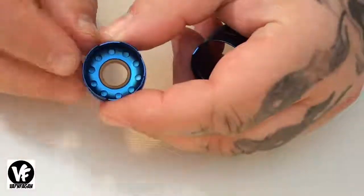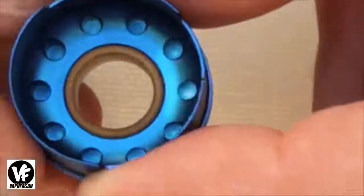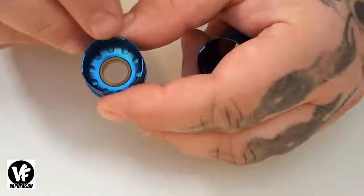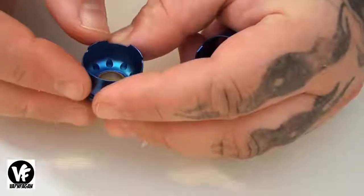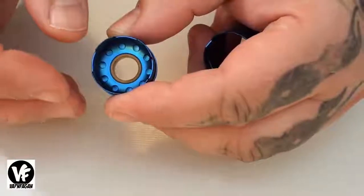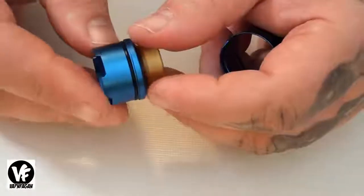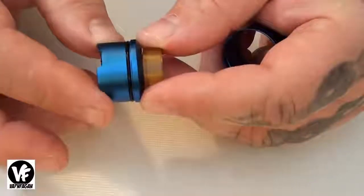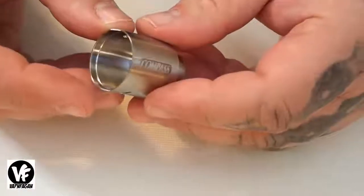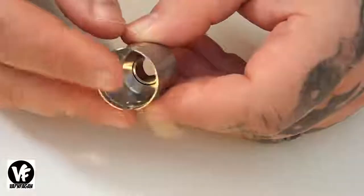At the bottom we have 'Designed and Manufactured by Steel Vape,' a non-adjustable gold-plated 510 pin that sticks out far enough to safely use on a hybrid connection, and a Phillips head screw to access the negative post. The blue aluminum top cap has very nice machine work — no sharp edges. It is a little thin but that's expected with aluminum. There are some milled-out holes on the cap that don't go all the way through, just a few millimeters deep — supposedly to improve flavor. The anodizing holds up very well in an ultrasonic cleaner.